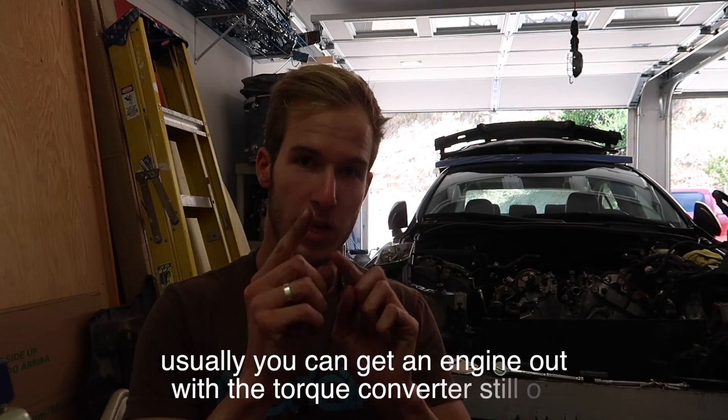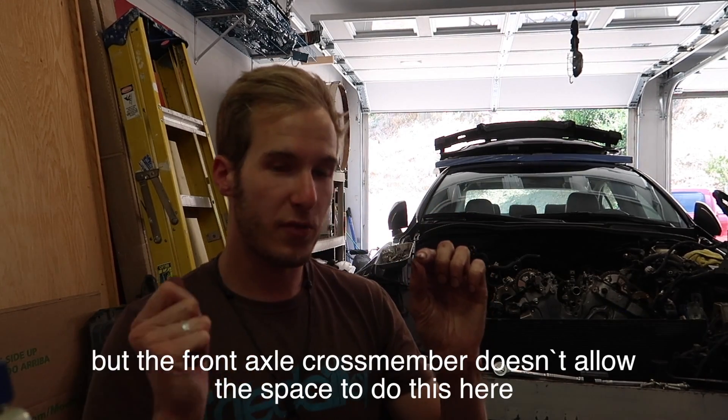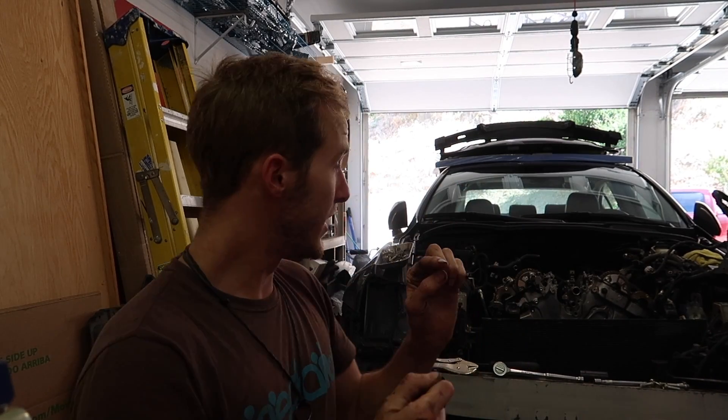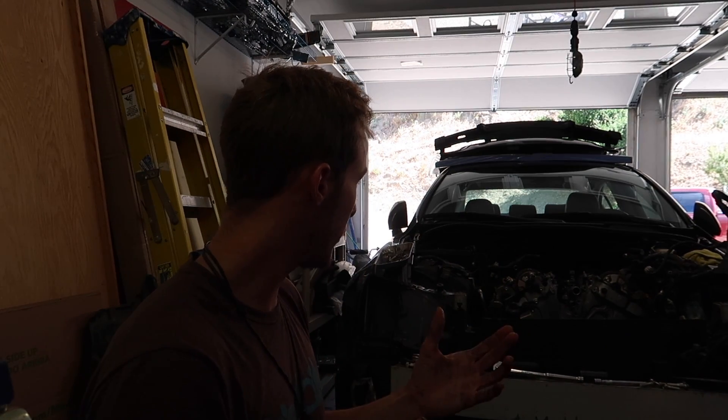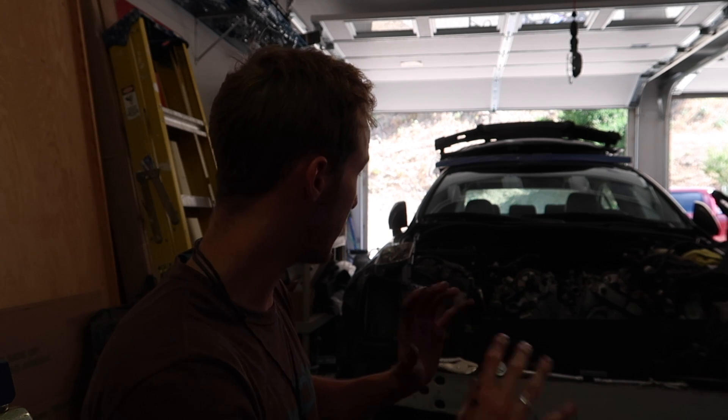In order to do this, usually you get underneath and there's a slot between the bell housing and the engine to get the bolts off. But you have to crank the engine to get all those bolts out. Since this one is completely destroyed and 100% seized and we can't crank it right now, even with a huge ass cheater bar, we're trying to basically get everything off the engine right now — cams and everything — to somehow maybe be able to crank it later and get it off that flywheel.